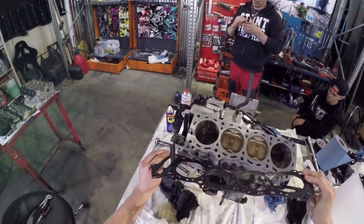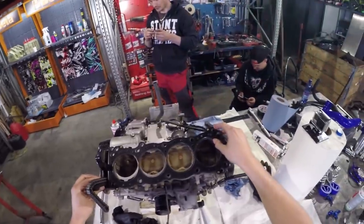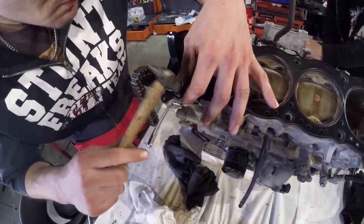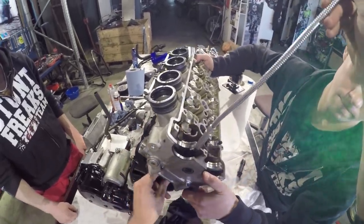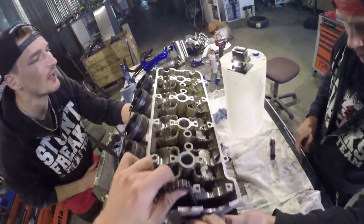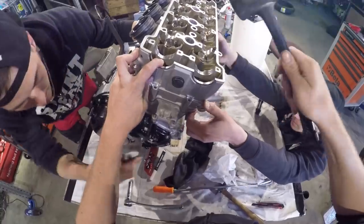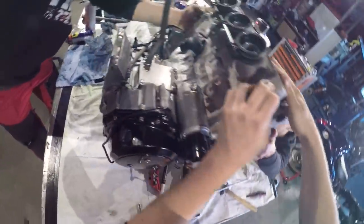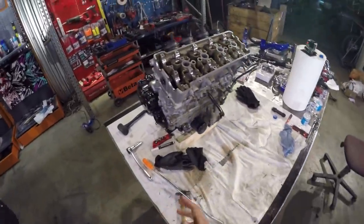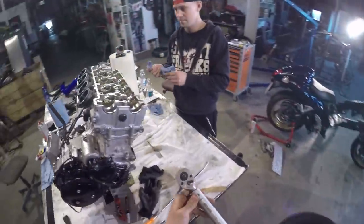This goes here. That one goes there. Now the chain won't drop like that. Then we can tighten the cylinder bolts. The tool you will need is here. In Finland we call this momenttiavain, and the direct translation is moment wrench.